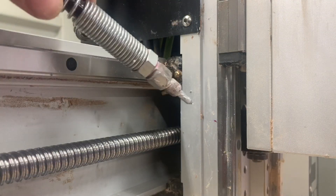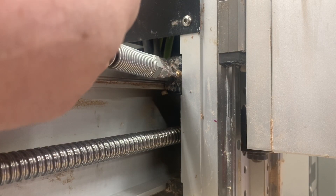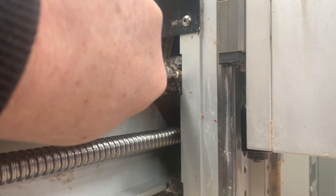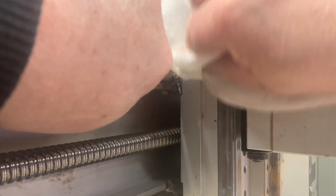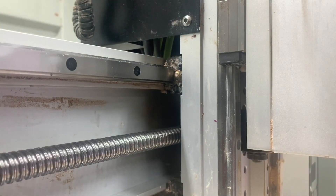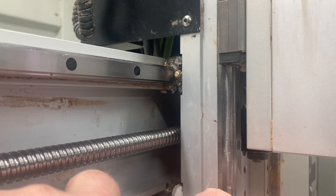With this needle fitting on the grease gun, just press it into the center of the grease zerk. You've got to put a lot of pressure on it — push it in. Just a couple of shots of grease is all it takes, then you've got to take the paper towel because you're going to lose some grease due to the pressure in the hose. Then we'll do the bottom one. Lost a lot of grease there.